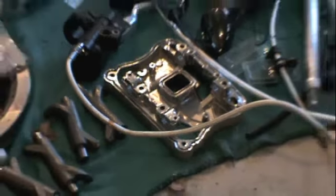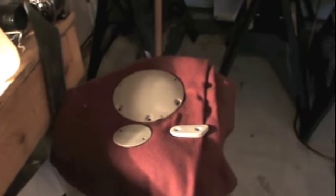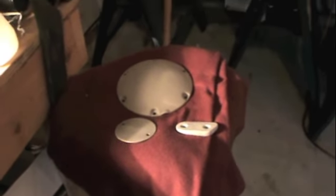I did powder coat one thing, actually one of those lower rocker box covers. I had powder coated the outside. I sanded it down, I must have spent over an hour sanding it with 4 different types of sandpaper. I went from a real heavy grit and I got lighter each time. I powder coated it, and the next day it flaked right off. It didn't even stay on. So I went to the place I go to locally here, and I had it blasted, and I'll do them both over again.